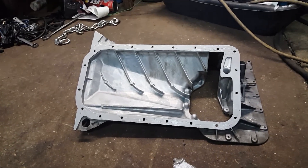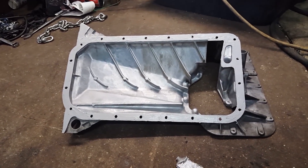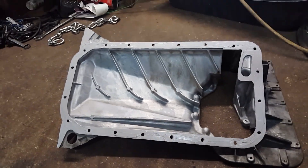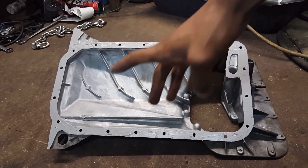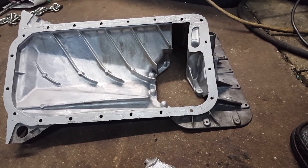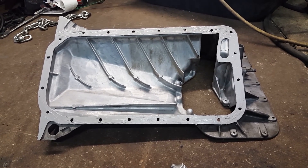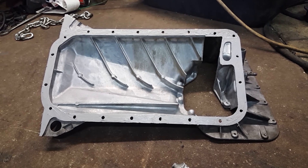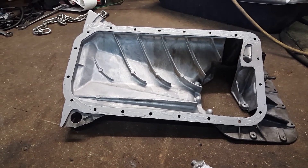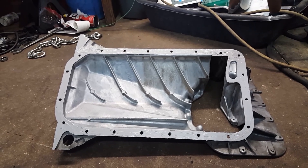I've got the gray Permatex silicone gasket maker applied. Another benefit of doing this is it will hold the actual gasket in place. I don't use too much because when you tighten up the oil pan it's going to squish that out, and if you use too much it will get into the oil pan on the inside. If you use a whole lot, that can drop into the oil and get sucked up into the oil pickup, which will block the oil pickup and starve the engine. You just want enough so that it will hold the gasket in place while you're installing the oil pan, and to make a slight double barrier to give the gasket a little bit of extra life.